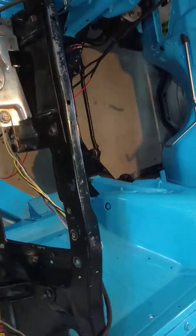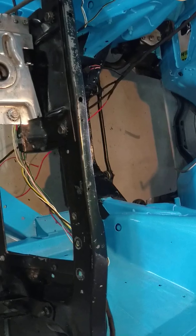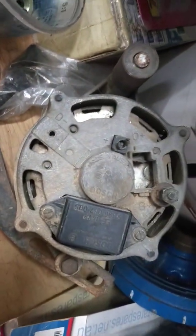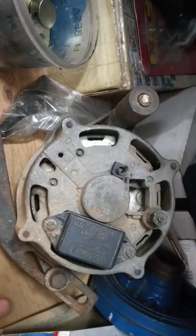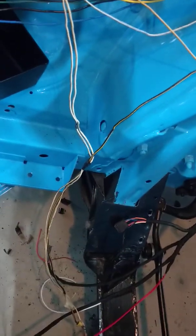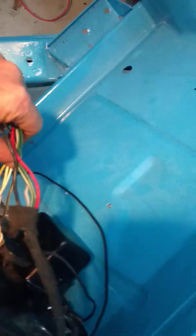This is a video about a 1971 Ford Falcon with an external voltage regulator. What I discovered is that after I'd done all the wiring and reconditioned the voltage regulator, I then looked at the alternators that were going to go on it — they're all internally regulated alternators, which is what the black box is, and they're the same on all the motors I have. So there's no point in wiring up an external voltage regulator when it's already on the alternators.